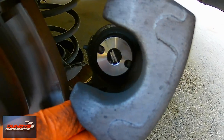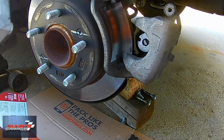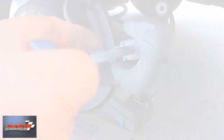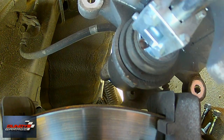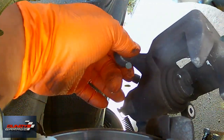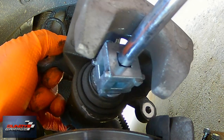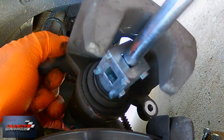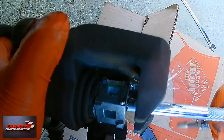So there's the brake caliper piston — that's what I've been talking about. You have to turn that clockwise to get it back into the brake caliper. There's a special tool that you need. I just have a 3/8 extension on a 3/8 ratchet. The cool thing about the tool is it has different options for different kinds of pistons. The two holes that you see there are probably the most common application — they have just two holes on the outside that are 180 degrees from each other. Just take your time, make sure the piston is recessed all the way back into the brake caliper. If you go to put the brake caliper on and it's not going on, double check and make sure the piston is pushed all the way in, because if it's not, you're not going to get the caliper on.